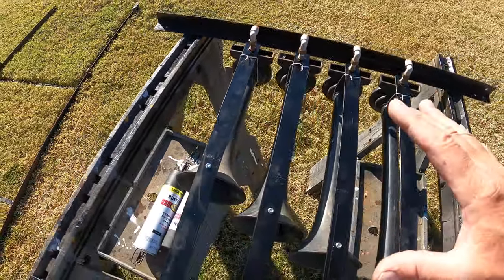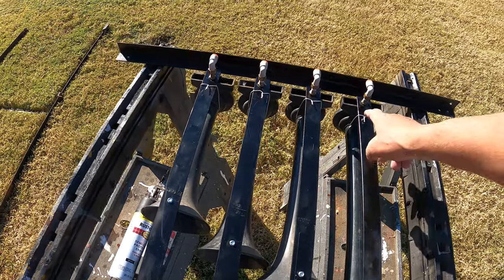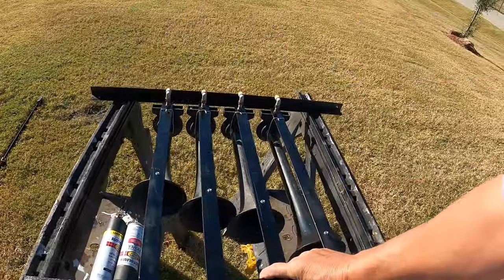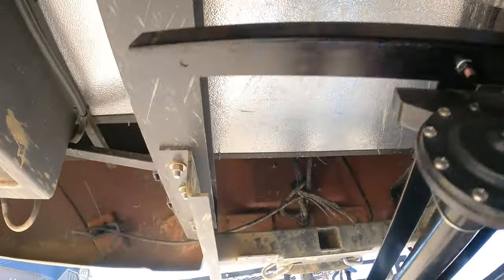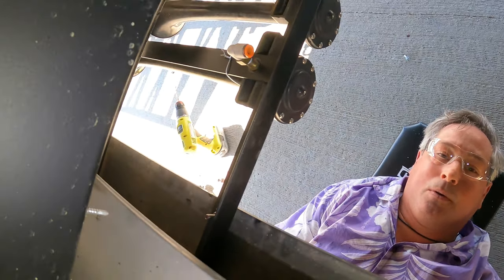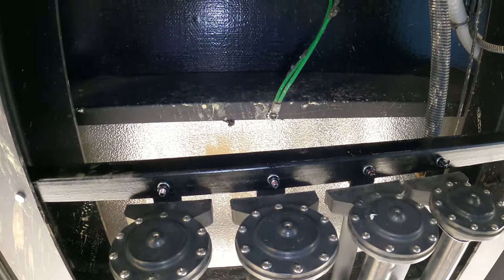The horns are actually only held in place by the little screw and the air fitting. That kind of concerned me, so I went ahead and put a little safety wire wrap on there. So we're going to head over to the coach, get on the creeper, and see about mounting it. This is where I'm going to be mounting the horns — right under the back of the coach just forward of the receiver hitch. The horns are mounted. No one's going to be looking under here anyway.